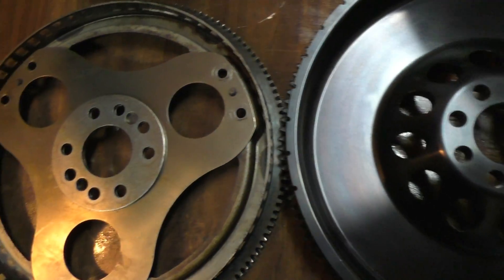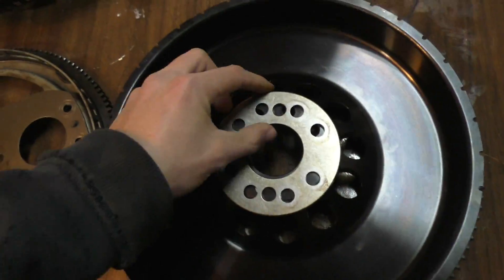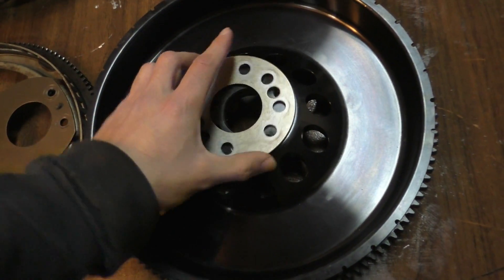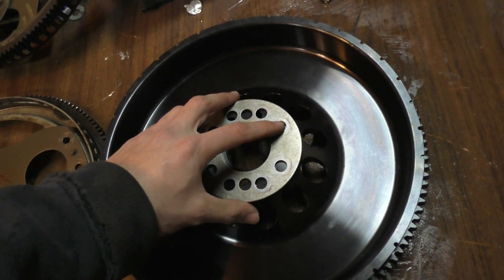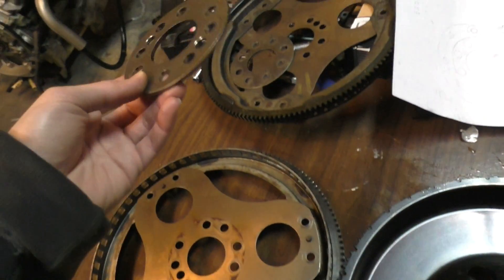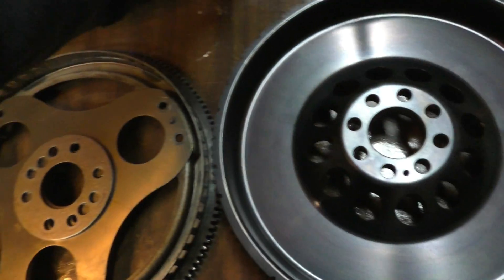The problem with the CLS engine is that the bolt pattern is pretty weird — there's no way to make it work that simply. It also has eight bolts, but they're arranged in a really weird pattern: these two bolts are 45 degrees apart, but then these two bolts are only 36 degrees apart, with a large gap elsewhere. I have no idea why they changed the design, but I've come up with a way to still make it work.